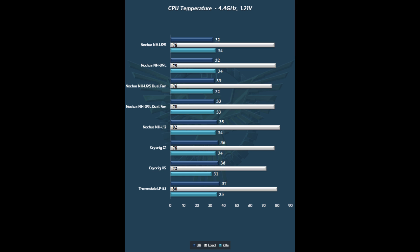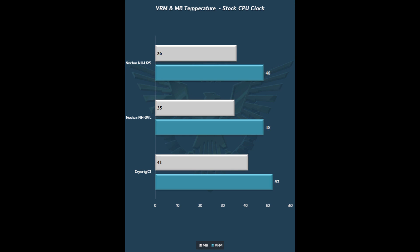That's going to be especially important if you're doing a gaming rig, not just an HTPC. We did one final test — I moved them into simple tests with the CryoRig C1 and the two Noctua coolers in a Node 605 case using a Z77 Mini-ITX motherboard. We wanted to see if there was going to be a palpable difference in the VRM and motherboard temperatures in a small enclosure. We absolutely saw a drop in temps — about four degrees on the VRM, and about five to six degrees on motherboard temps respectively, because of the horizontal cooling flow of the Noctua coolers.